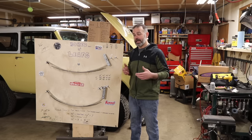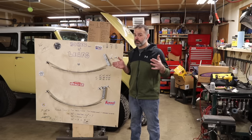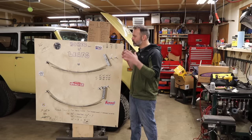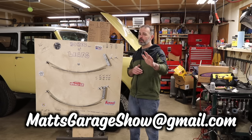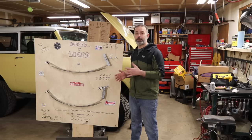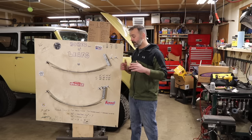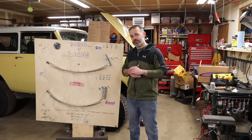The bottom line: if you want more droop, you need more shackle angle. And if you get a lift kit where your springs are more arched than the original but the flat length is the same, you have to adjust your shackle hanger location. I hope this tech was interesting. Shoot me questions at mattesgarageshow@gmail.com, leave a comment below. I'm not quite guru level, just trying to learn — so don't torch me if I got something wrong. I want you guys to make your own board of leaves and help teach the world more about suspension technology. Thanks for watching; I'll see you next time on Matt's Garage.